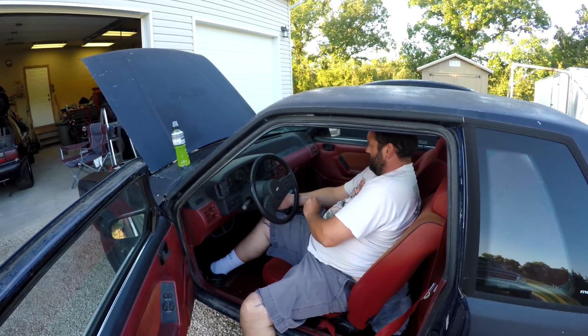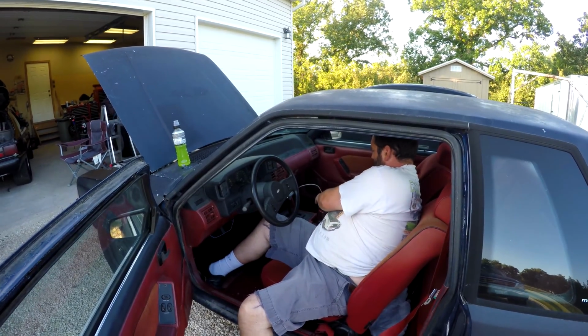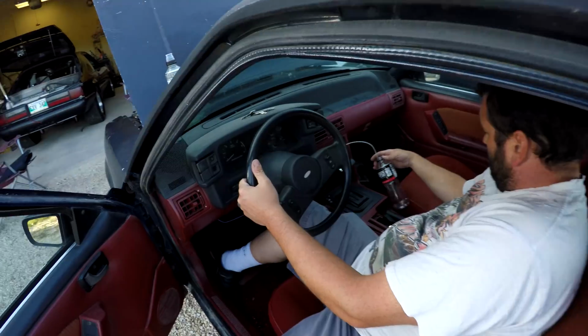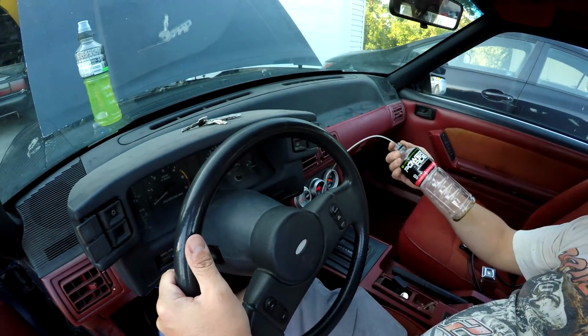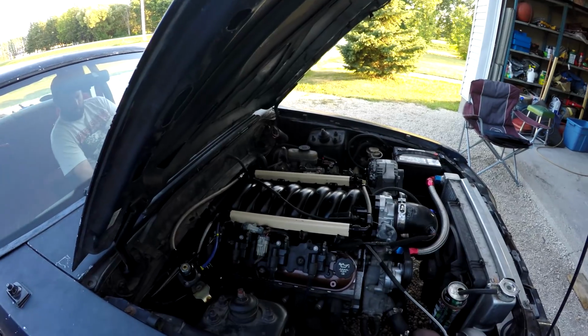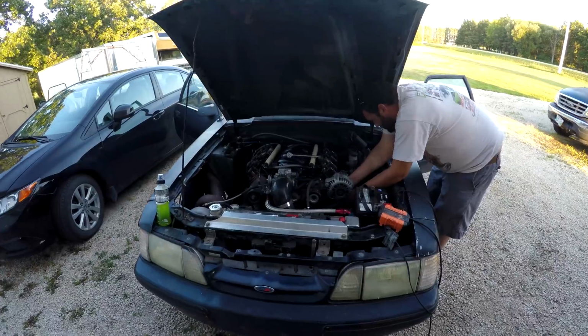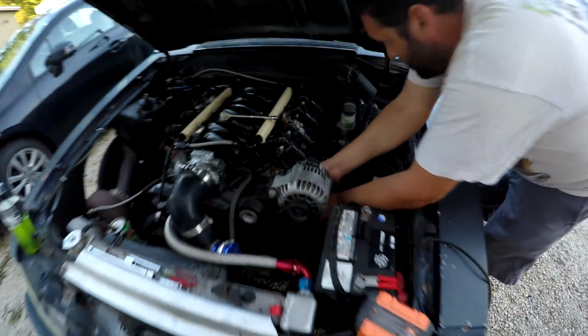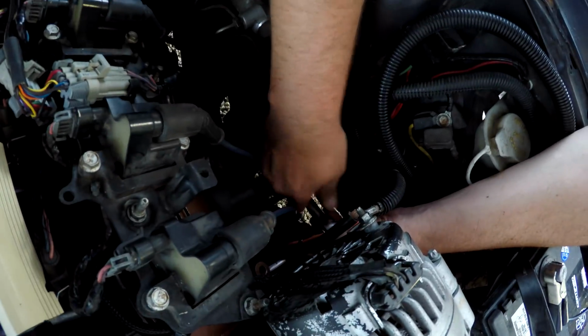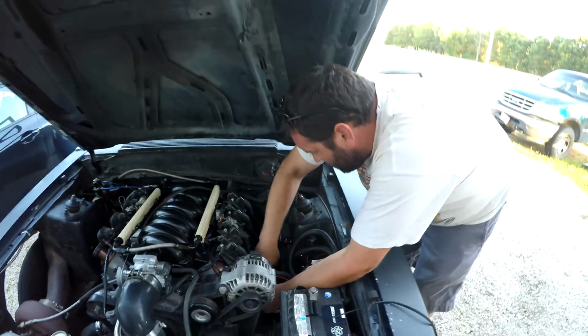I mean, it's possible I might have to tune some things just for it to run with the cable. I'll have to Google it. Some new electrical gremlins, it seems. The air fuel gauge is staying on. The fuel pump wasn't priming right like it should. And the 2-step has power too. Maybe disconnect the battery and then we'll do some figuring. So after a bit of noodle scratching in there, we found the problem. I was checking a few things out, but it ended up being a ground wire that was attached to the battery's positive terminal instead of the block.